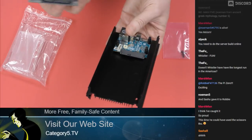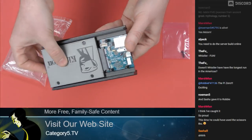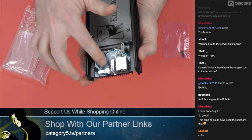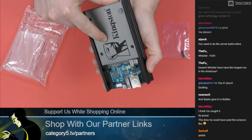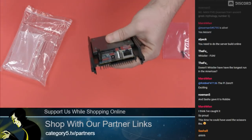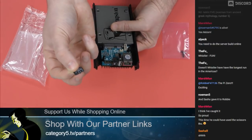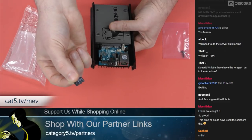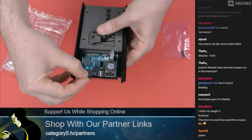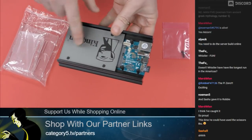It has an SATA 3 header built right into the board. So what does that mean? We can take our Kingston SSD — I've got a 960 gig, or one terabyte drive — and I just simply slide it in there, and boom, now it's part of the device. When I boot it, I'm going to have access to this drive for storage. It does boot from an SD card; I've got a micro SD card with Maverick's Debian Stretch installed on it. You can download that at cat5.tv/mev, which will take you to the forum thread for that image. The OS boots from the SD card, and the data is stored on the SSD.